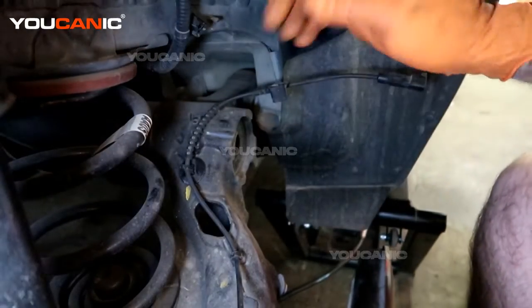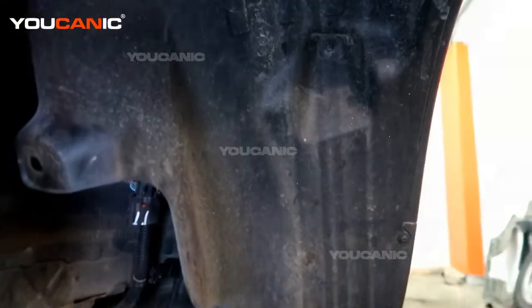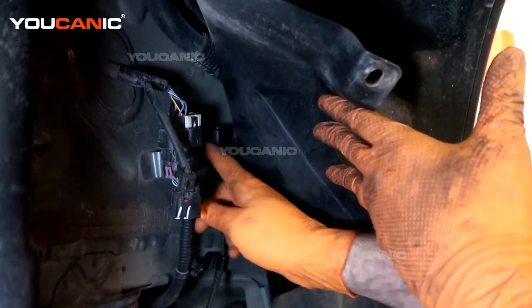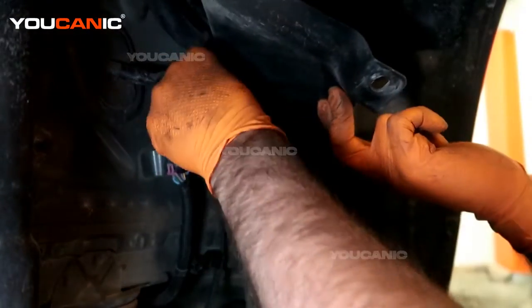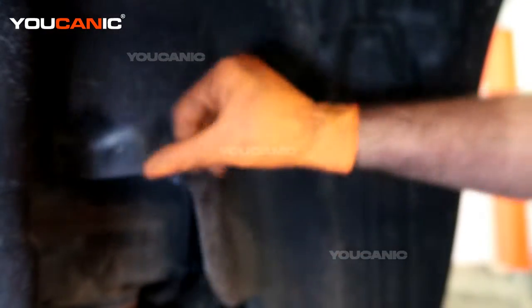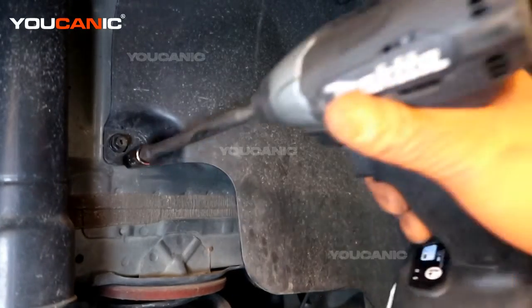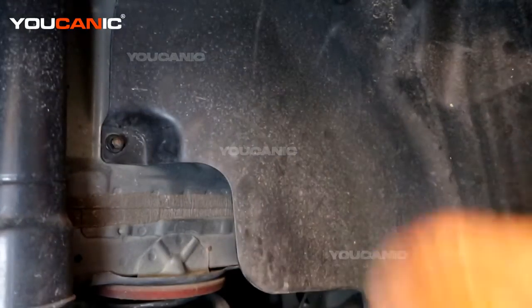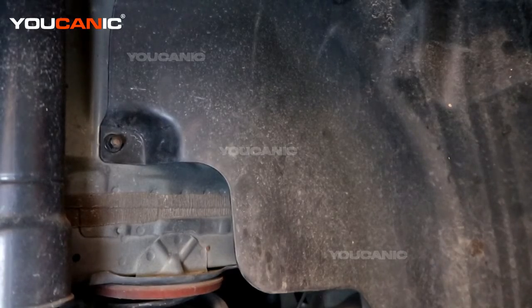Pull the fender well back and install that clip. Work your way up, slide that over, and push this clip in. Go ahead and hook the electrical connector back up and press until it clicks into place — it's locked on. Finish by installing the number 10 plastic nut. That's how you replace your rear ABS wheel speed sensor on your 2019 Chevy Trax. Thanks for watching — you can be the mechanic.